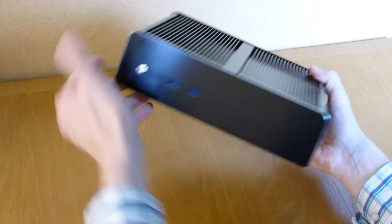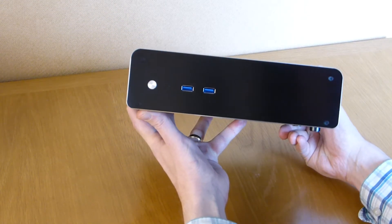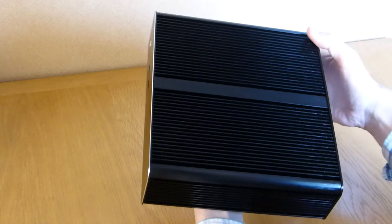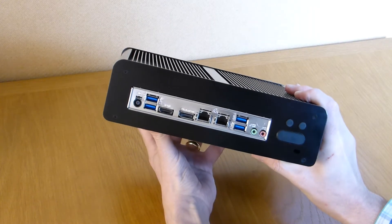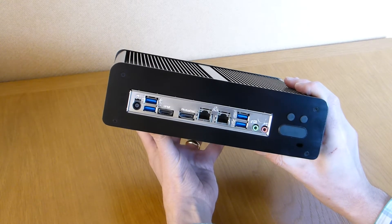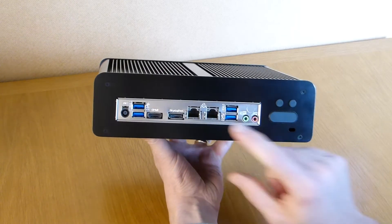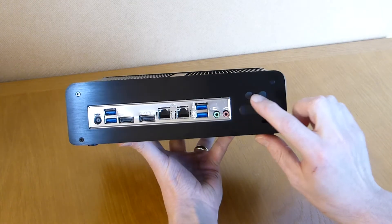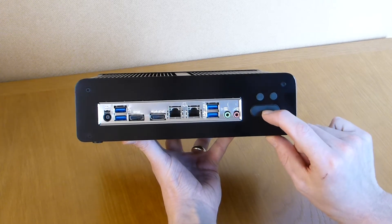The T series is an evolution of the S series design. On the front are two USB-3 ports, power switch, and power and disc LEDs. On the rear you can see the Q87T motherboard with four USB-3, HDMI, DisplayPort, and dual LAN, together with audio output. There are also options for an external antenna for Wi-Fi and RS-232 serial.